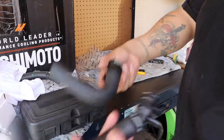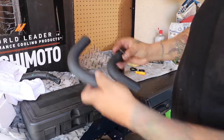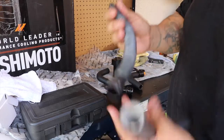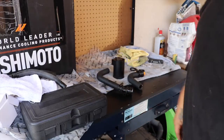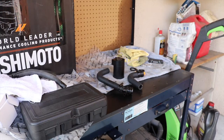Took off the other hose. This is what you're supposed to do — obviously you've got to tighten this part still. Mishimoto has a video on how to do it. You're supposed to heat this up and pull them off, but as you can see one of them didn't come off — I had to grind and cut it. So if you ever decide to come back to stock, you'll have to buy a new hose, so just be aware of that. That's pretty much it. Put some of this stuff back on — not the catch can — then put the other charge pipe and see how it goes.